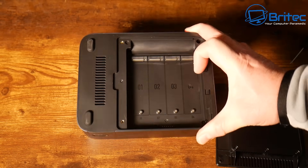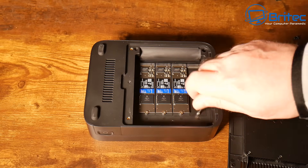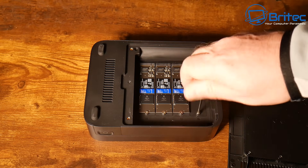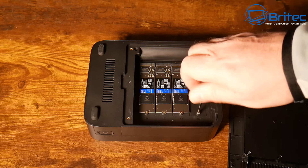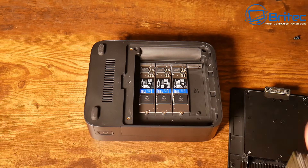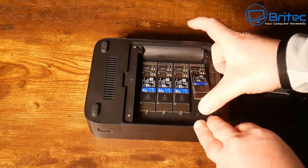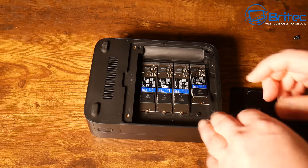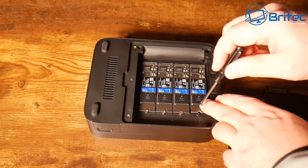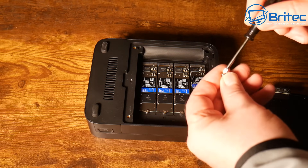Things should run pretty cool - we have room for four NVMe drives and no other drive types can be added apart from these four. I'm going to put in four one-terabyte drives for tutorial purposes, but the website states you can have up to four terabytes times four. You can run these in JBOD, Basic, RAID 0, RAID 1, RAID 5, RAID 6, or RAID 10 depending on your preference.